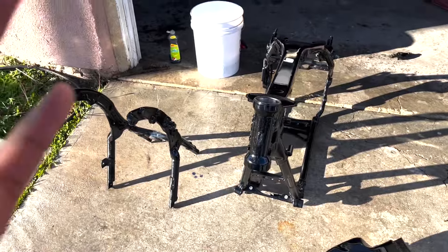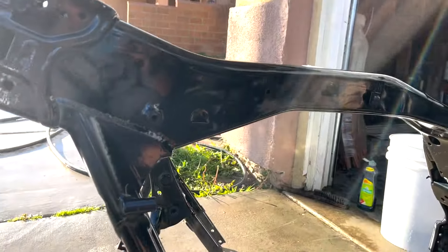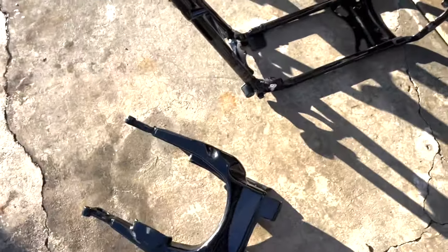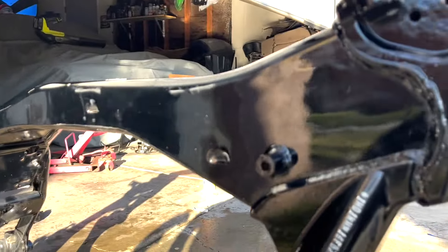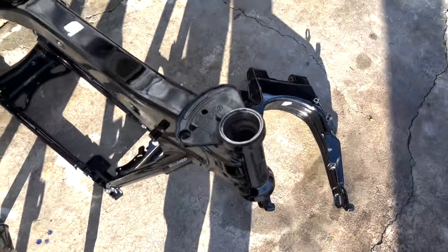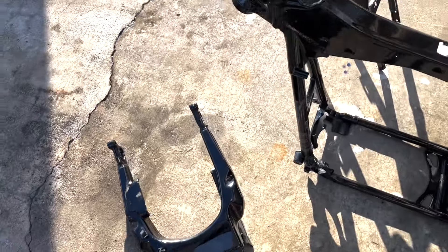We just cleaned all three of these things up. Like I said, this is something you don't have to do — you literally don't, especially when you get a sandblast because they're gonna clean it up. But the fact I'm about to stuff it in my car, I want everything nice and clean. But I do this anyway even if I was right around the corner from the powder coat shop — just to make sure I did my part. Now what we're paying for, they must do. But I gotta realize this is clean but it's not even the cleanest. I just degreased it, hand soaped it, and hand washed it. Think about people that's powder coating their frames and not even doing that — your boy is trying to be cautious. That's why I said we get all this stuff sandblasted, just to make sure it sticks to the frame. I've seen two people powder coat stuff and knock the whole powder coat off, so sandblasting is important.